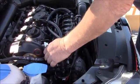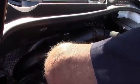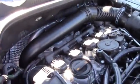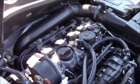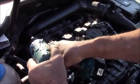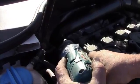Now we need a boost suction. So what we're going to do is get the clean side. We're going to deal with that later when we develop a proper mount for our clean side separator. So we're going to take a 1/2 inch drill bit and put some grease or Vaseline to keep out the shavings. The plastic shavings are going to be minor and not going to be an issue.